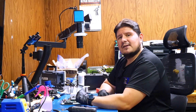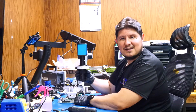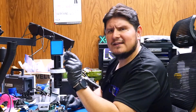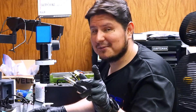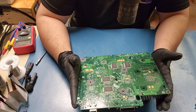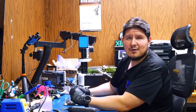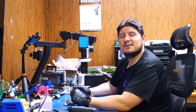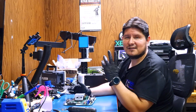Because I didn't have enough coffee this morning I ended up missing something — I wonder if anyone caught this before I did. The seller cut the clock capacitor off. Lazy man's clock capacitor removal, and as you can tell it's still populated. Most likely they just violently bent the thing and then cut off the legs and vacuumed up their evidence. That said, I would say this XDK — as it's commonly termed — is in immaculate condition. The console will most likely provide many more years of use and in its present condition, at least for this one, it's good to keep on the shelf.